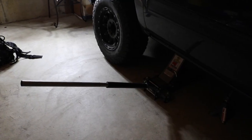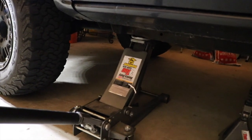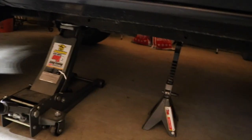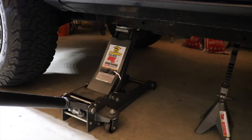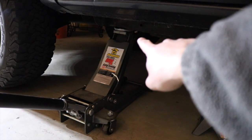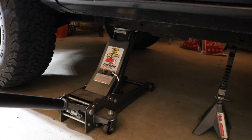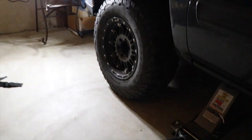If you're replacing the brakes on your Silverado, the first thing you're going to want to do is jack the truck up. We have a jack underneath the truck and also a jack stand for safety, to make sure just in case the jack fails that we're not going to get crushed. First thing you want to do is make sure you grab your frame with the jack, jack it up as high as possible to the point that the wheel is off the ground, and then take the wheel off.